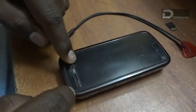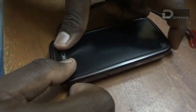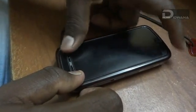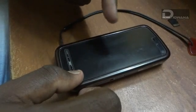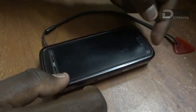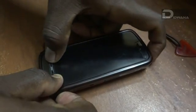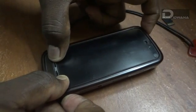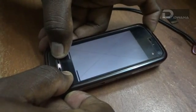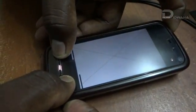To hard reset, we just need to press the call button, the end button, the camera button — three at a time — along with the power button, and the phone should be off. All four buttons should be pressed at a time and we need to press and hold all the buttons till the system starts, the booting starts, and the phone starts up. I will let you know when to remove your hand from the button. These three buttons are pressed. Did you hear that vibrating sound? Just remove your finger from the power button and press and hold all the three buttons till the booting comes up.